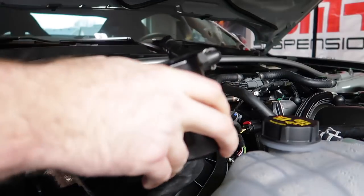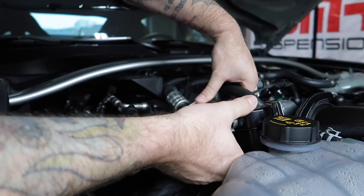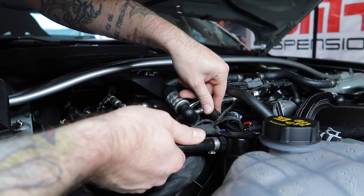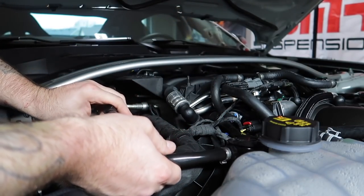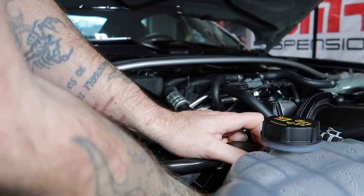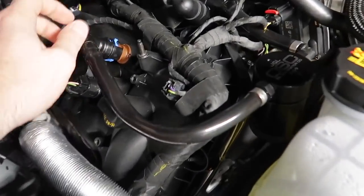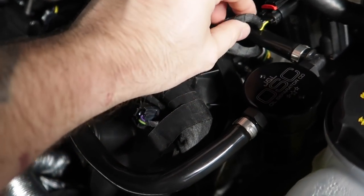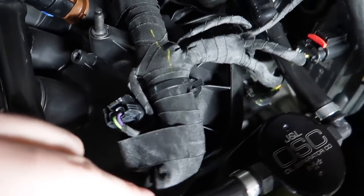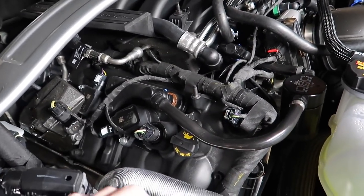This is in a sense also a performance modification, so let's install it real quick. Come under some of the wiring here — this can rotate a little bit if you need it to. I want to come under all this. It's safely between there, it's not going to pinch any wires. Clip down — there we go. Rotate a little bit, snap and snap. Make sure the catch can is fully seated on the O-ring, it's tight, you don't want any leaks. Secure here, secure down here, safely through the wires, not pinching anything.